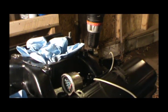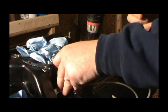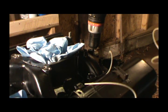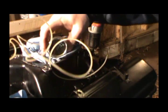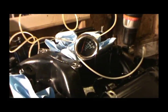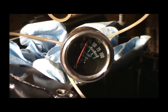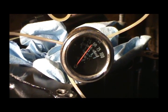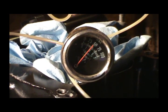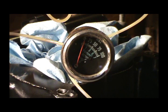You can hear it when it picks up — that's the oil coming out now. Probably just drained it all back out when I picked it up. Let's go look at the oil gauge and see what we got. About almost 50 pounds of oil pressure on it. Well, at least we know our pump's primed and we've got oil flowing — that's what we need.